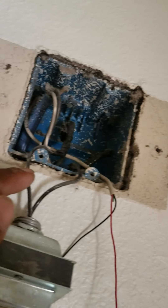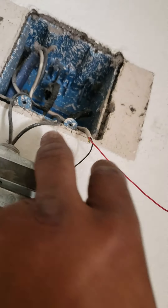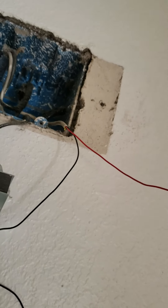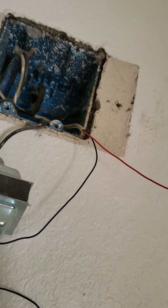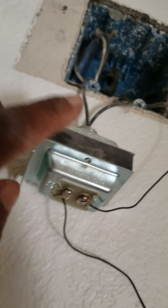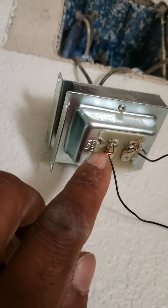Go ahead and turn all the power off. It's just a white wire and a black wire coming out of the wall that you tie in. The two smaller doorbell wires coming from the front — those that I was working with at the front — should already be wired to the door, so don't worry about those.